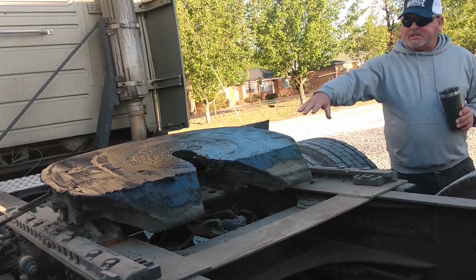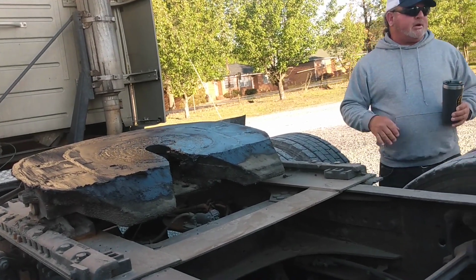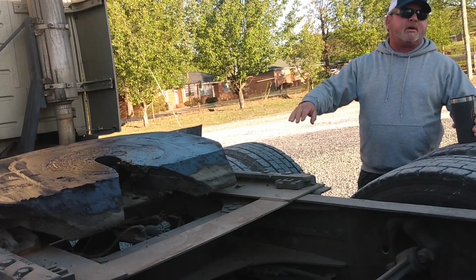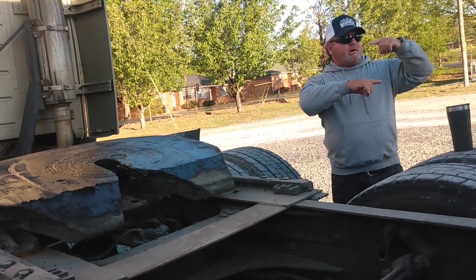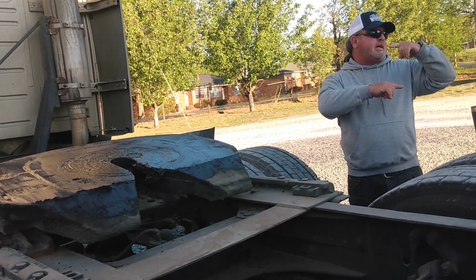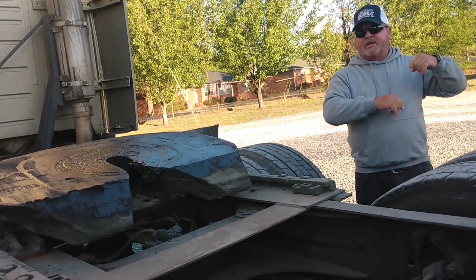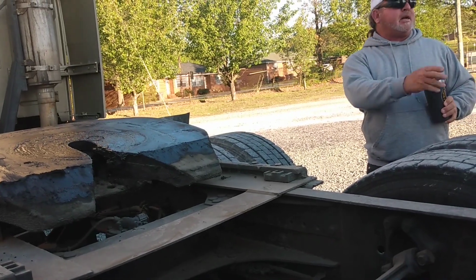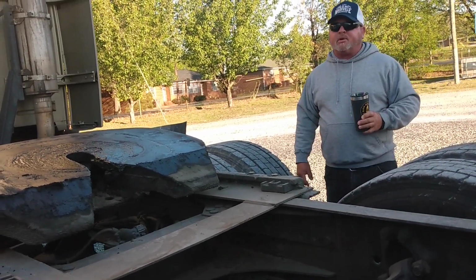Right? So always check this. If you're out on the road and you don't have anything with you, if you see you got a spot that's got friction going on, hanging on the handy wall, they have these packs that look like oversized maybe salad dressing packs full of grease. Just throw a couple of them on there, back onto the trailer. You're good. You can get to where you're going. Okay?